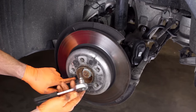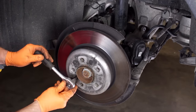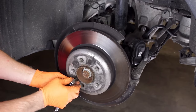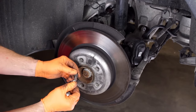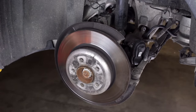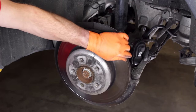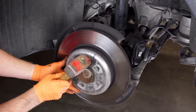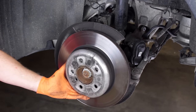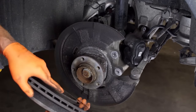Loosen and remove the rotor securing bolt using an Allen bit. Before trying to loosen the bolt, be sure the bit is fully seated and secure into the Allen recess. The rotor is ready to be removed; however, there may be enough corrosion at the hub flange to prevent removal. In this case, a hammer can be used to help loosen the rotor. Hit the face of the rotor's mounting hub. If this does not free the rotor, hit the inside face of the rotor's friction ring. This should only be performed gently or if the rotor is not to be reused. You can see the rotor wear more clearly when the rotor is removed.